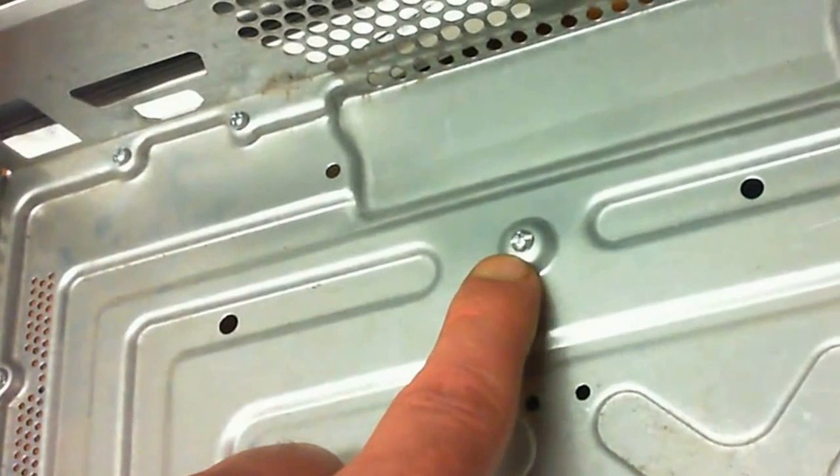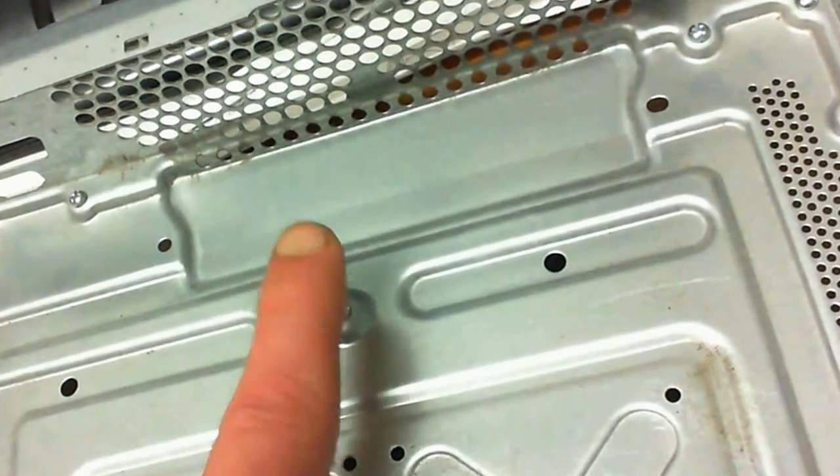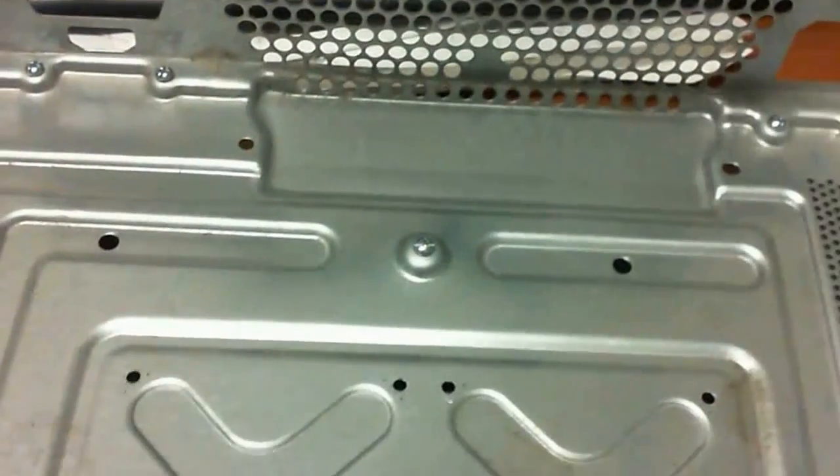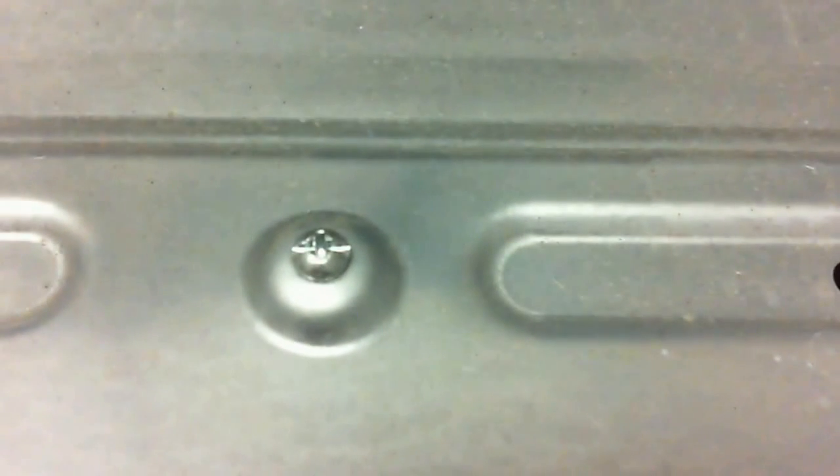That'll also show you that they're the exact same height by the ruler actually making contact here as well as on the upper ridge of the case screws. Okay? So that is conclusive proof that these standoffs are not 0.75 millimeters or 1 millimeter as claimed by their video higher than the rest of the standoffs. In fact, according to these screws, the entire motherboard, with standoffs included, is absolutely flat. Wow.